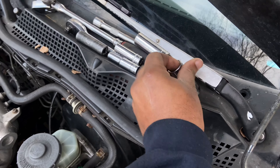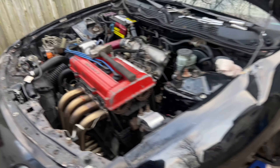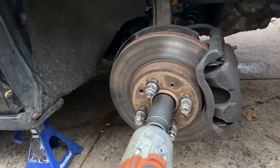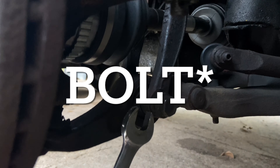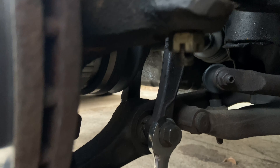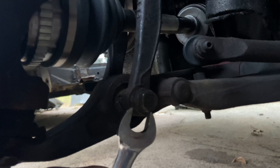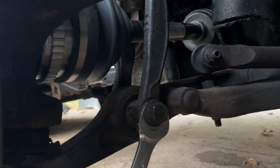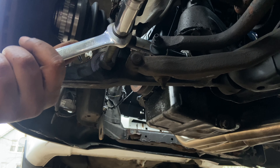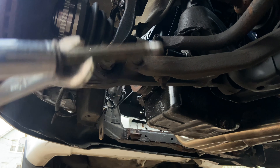I pretty much got almost everything I need to start getting the transmission off. Next I'm gonna take off the 17, and then the two 17s are here for the lower control arm line for the fork. If you can't get the socket out just by turning it, you can either bang it out or put a ratchet on it — as you turn to loosen it, you pull at the same time and it'll come right out. Like that.